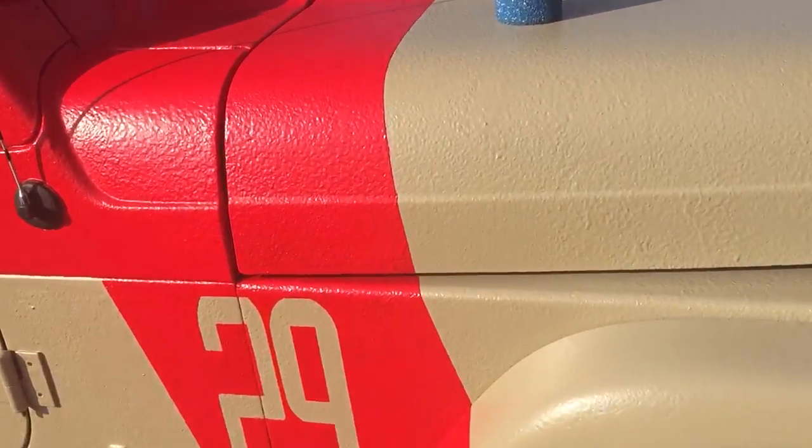Because the red had to cover so much, it's very, very thick, and you'll see where my masking lines were. There's a pretty good thickness differential there. And the lines masked really, really sharp. It was just that we had built up such a thick layer of stuff that when we tried to peel it, it's gonna kind of ooze, and that's where a little bit of the imperfections in my line came up.